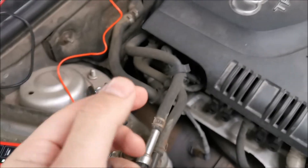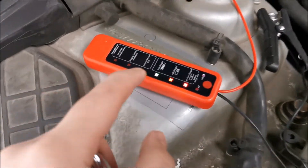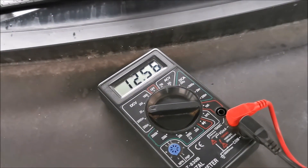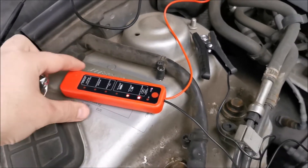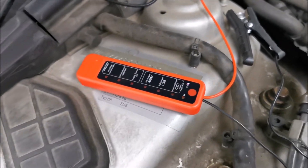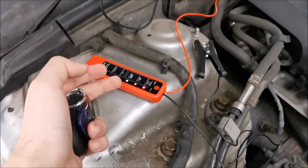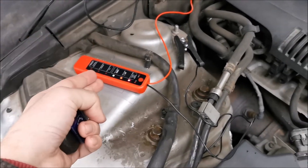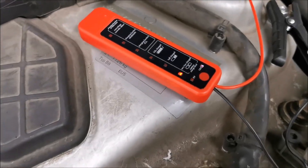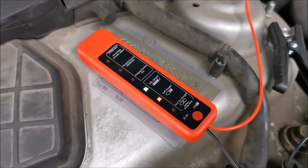After shutting off the engine you can hear the relays clicking inside as systems go into standby. The tester shows fully charged and in voltage terms we reached 12.56 volts. Overall this is a really good product. For 12 volt batteries it works exactly as intended. Just understand that when testing newer cars with lots of electronics you need to account for that. For directly testing a battery it's extremely simple and reliable. It does what it says. Thank you for watching — if this helped please give it a like and see you in the next one.